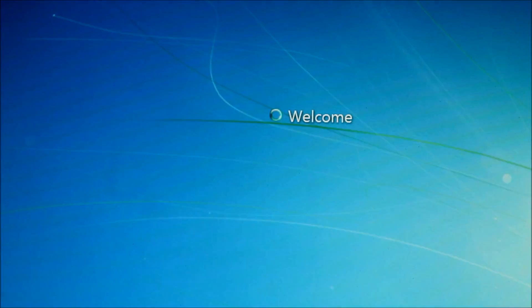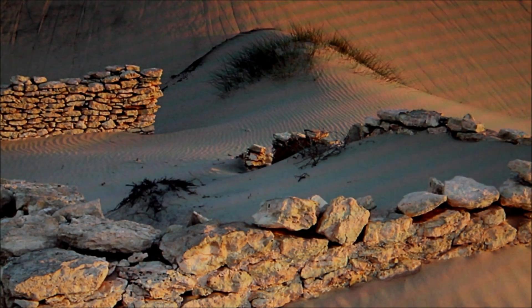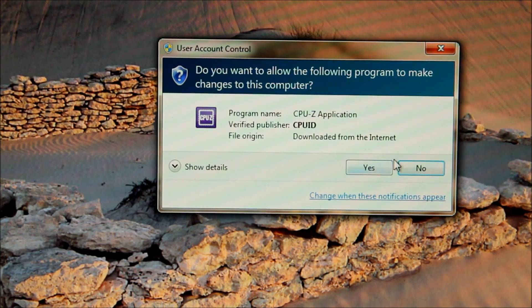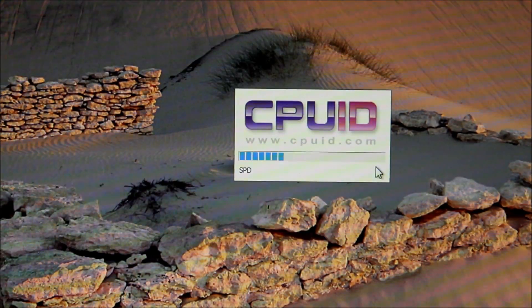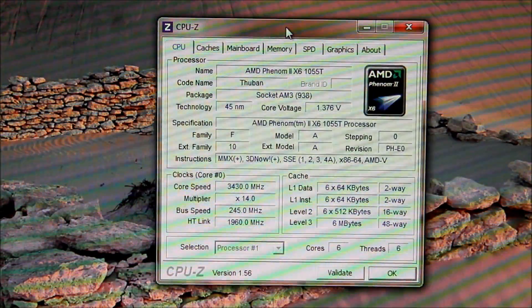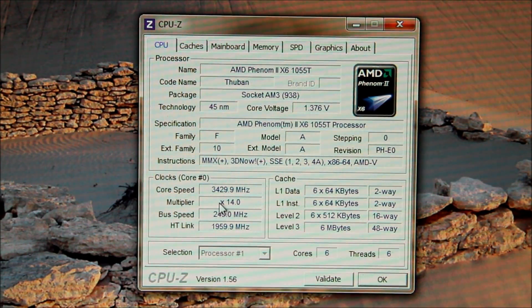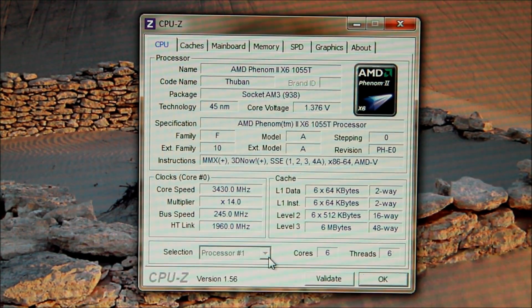You need something to monitor the temperatures and see what you're actually running at. Here's CPU-Z right here — I'll open that real quick and show you that we are running at 3.43 GHz. You can see there we're running at 3429.9 MHz. Now if we waited long enough, that AMD feature would kick in and actually drop it down to about 900 MHz.